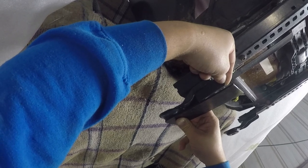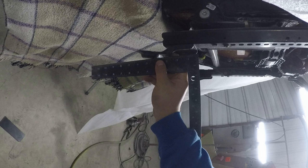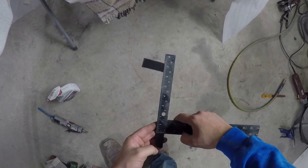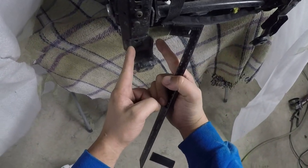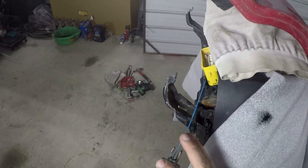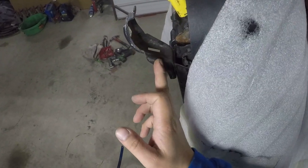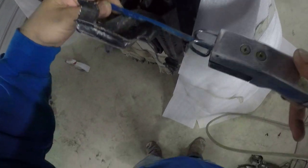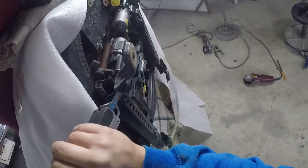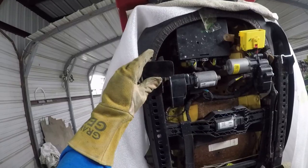So we're gonna make our bracket from there — it measures right about an inch and a half. That right there will fill in both sides, because those are going to attach to the sides of the cut. The cut you're gonna make here goes right where this little rectangle ends — make a straight line all the way across and cut it like that. These plates are one eighth inch thick.